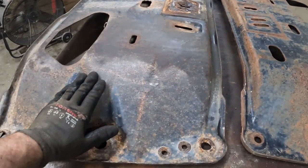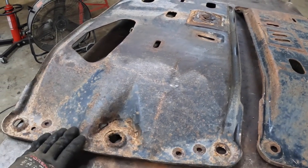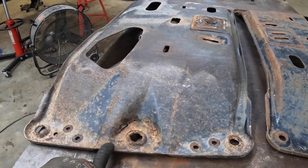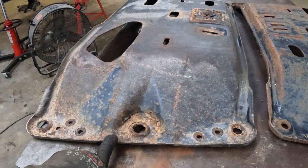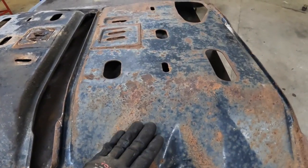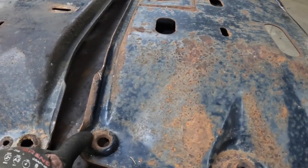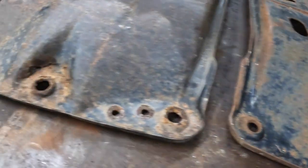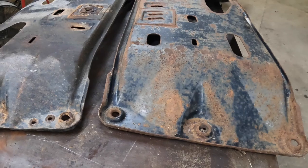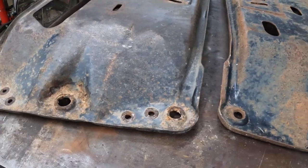So we don't recommend fixing these transfer case skid plates for the YJs. We do have some kits for TJs, but not for the YJs. You can purchase a new skid plate. We'll put a link to those skid plates in the description of the video, or you could find a used one, which is basically what we did. So here, essentially, still a little bit rusty, but all surface rust. You can see here how much better the holes are of this versus that. So make sure you get a good skid plate. Don't go doing something like what they did and just adding some bolts into the frame. That's a bad idea.